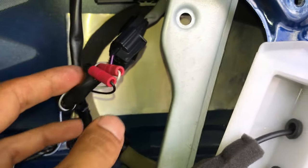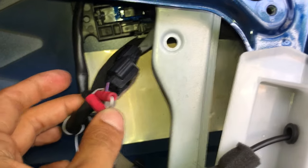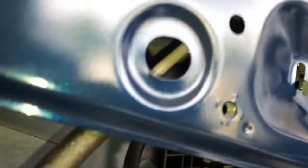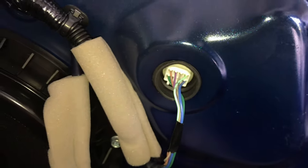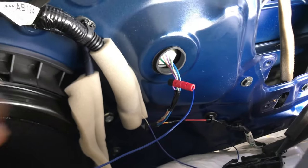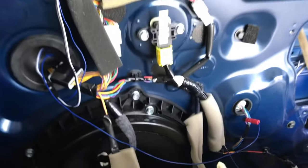Now connect this back and wrap it in electric tape so you don't have any exposed moisture or water getting inside the posi taps. Slide this back in place. Now route the blue cable and tap into the purple one here, which would be the DRL — the power to the DRL's purple wire connects with the blue. Now let's go ahead and tidy this all up.